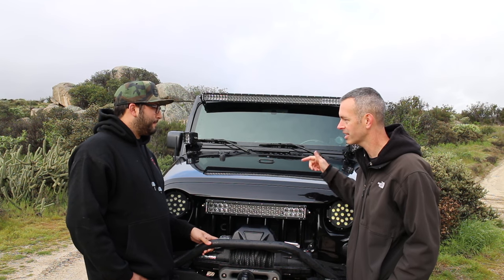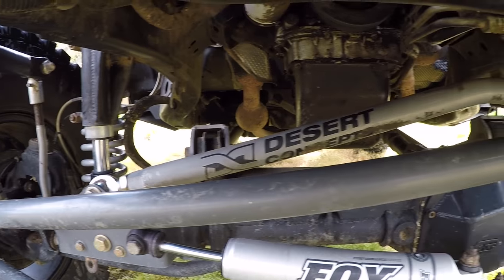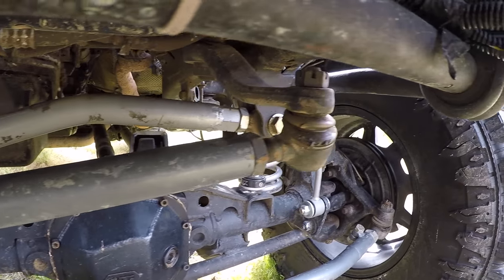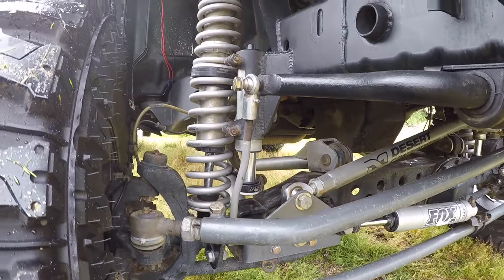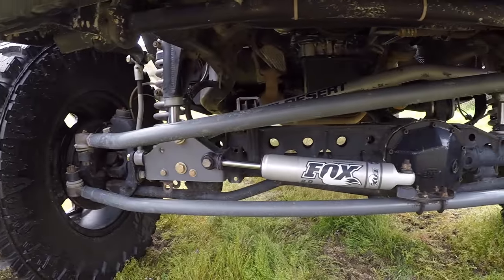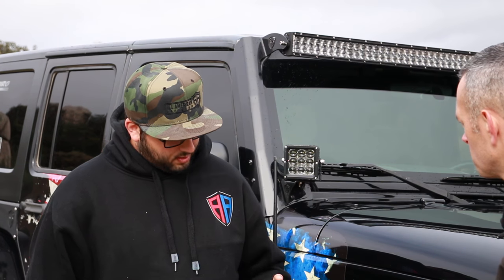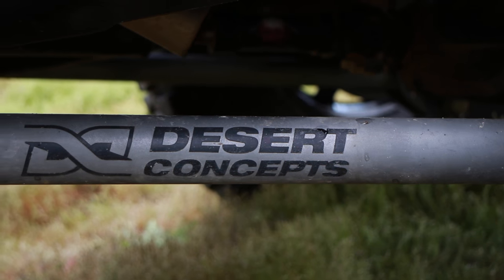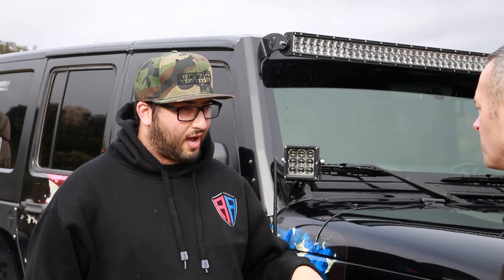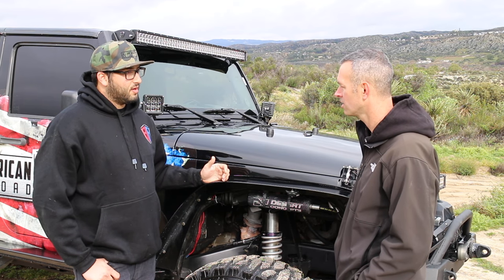Let's take a look at tires and suspension. I love the ride height — what kind of suspension are you running? We've got a custom kit by Desert Concepts — it's a coilover kit with 2.5 by 12-inch coilovers, roughly about six inches of lift. We've got hydraulic bump stops, a Fox steering dampener on the front, the Synergy steering kit, and finned reservoirs on the coilovers to keep the oil cold. This is a long arm kit with radius rods, all heim arms and heimed track bar mounts — it rides down the road really nicely and performs really well.